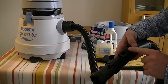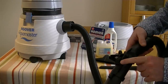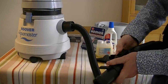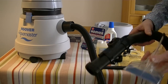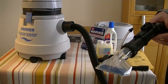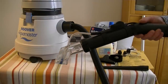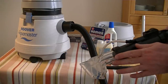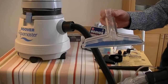And on the top here we've got the solution control. When you're storing it away, if you've got one of these, always store it in the open position. Because if you store it in the closed position where the shampoo is not flowing, it's at the front - if you store it away for a long period like that, it's going to kink the internal hose. So when you do come to use it and you release it to the open position, it could restrict the flow of shampoo. And I do believe Hoover did say something about that in the instructions. I'll just show you what it looks like with the upholstery head on - you just put the upholstery head directly onto the handle, and then you take the tube and you stick it in there. Now it's all set up, apart from it's not got shampoo in it. That's how you'd set it up for upholstery cleaning.